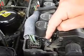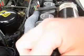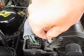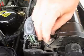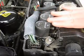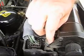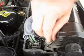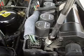As you can see, I've already fitted all 3 rubber grommets, and we put it back on the posts. Now it's time to remount the washer and nut assembly here, and it's very, very important that you do not over tighten this. A lot of people, when they notice the pump is vibrating, will tighten these bolts down some more. And that doesn't help the situation at all, because as we mentioned, there's a steel sleeve in there, and when you tighten this, you're not going to secure this anymore. You're actually just going to start bending these washers. So just tighten them down just enough so that they're snug, and that should be it.